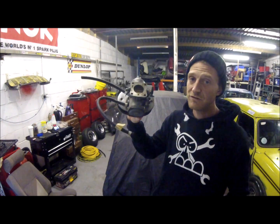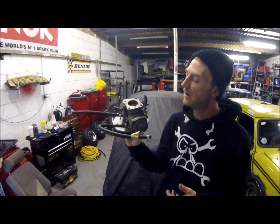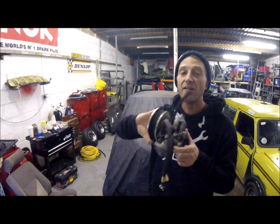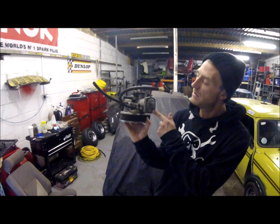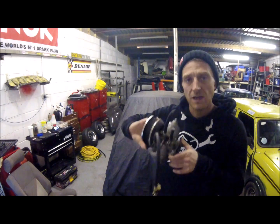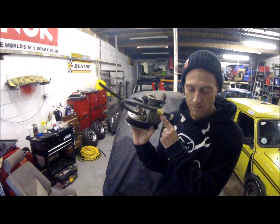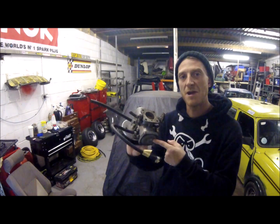I think I got an offer of one. I was going to buy a new one from Brighton. However, when there, Bug said to me that he's got an old carb that I could have and it's possibly a HIF, he wasn't sure. So he's brought this up here for me. I've measured it, it's 1 3/4 inches, but I'm not sure if it's a HIF 44. However, the float valve should fit mine and hopefully it won't be a leaky one and fill up with fuel like my other friend's did.